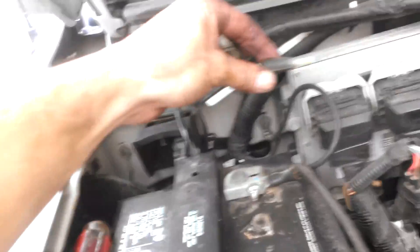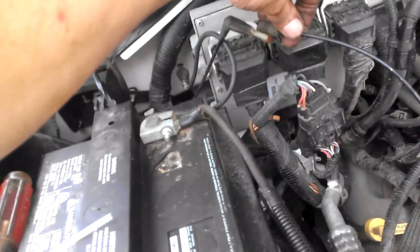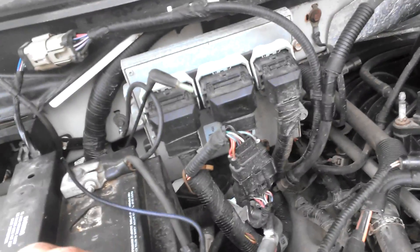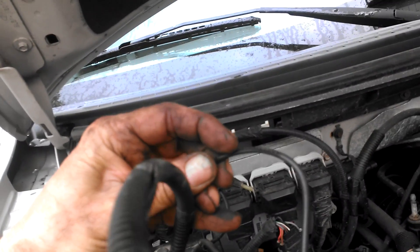Here's the connector that comes off the solenoid. This little piece connects right here on the end of this, and then it goes down along the firewall. I'm pulling on things, yanking on things, checking vacuum at this point, that point, wherever, back and forth. And right here — it's melted closed.